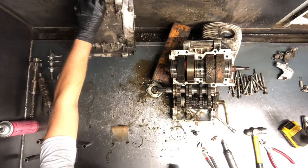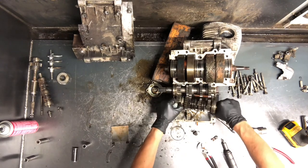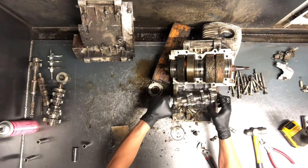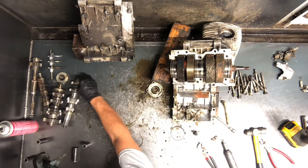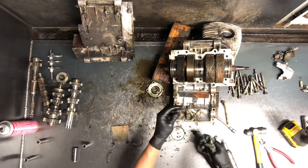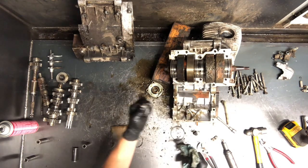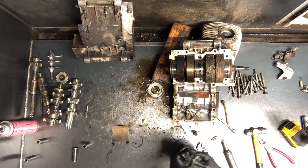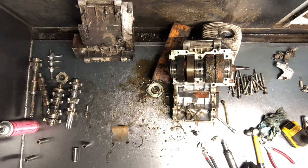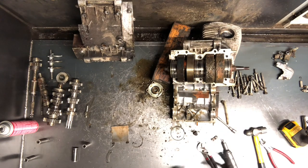Let's see how far we can get with this transmission here. These actually just slide up out of there. Then we've got this shaft here that slides out as well — the clutch sits on one, the countershaft sprocket sits on the other one. This is the oil pump gear here, just pulls out there. And the crankshaft — we're going to have our hands tied with that one. So that is tearing into a Suzuki GT500.